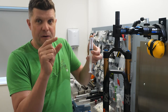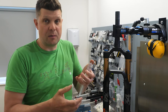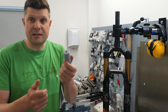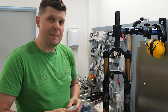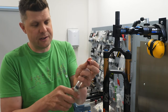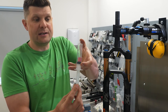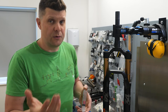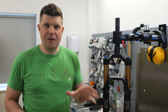At the bottom of the stroke — those first few centimeters of travel — it's very easy and doesn't take much of a hit. But as you get further up, it takes a bigger and bigger impact to compress that air. That's why we talk about volume reducers. If you've ever bought a bike or forks, you've probably seen these little spacers in the box. They unscrew and go into the air chamber, reducing the volume of air in there even though you're running the same pressure. So as you compress, the air pressure builds up faster. Depending on the fork you might have one, two, or even four spacers, and this is something you can fine-tune.